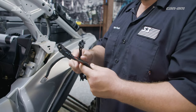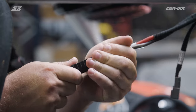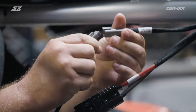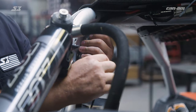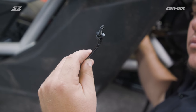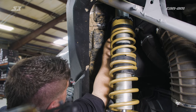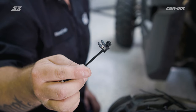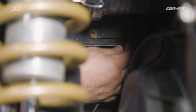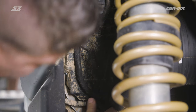First thing you need to do is locate the quick disconnect on the subwoofer. It can only go one way, but make sure your positive is lined up with positive and negative with negative. Using the supplied zip ties, go ahead and secure the wire to the cage. Run it along the back side working toward the center console so that we can go through the access hole in the center. There are some flat lips over here on the firewall — secure the style clip to it and then zip tie it. When running your wire through the back of the firewall, make sure it's not rubbing on anything sharp or pinched between anything.